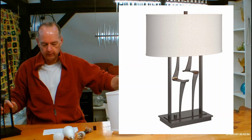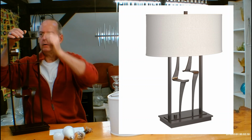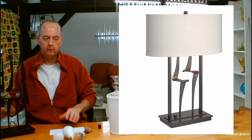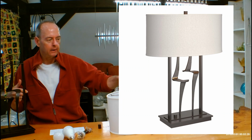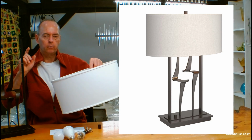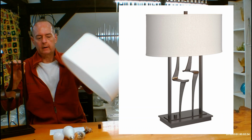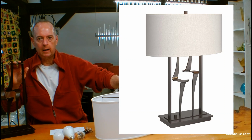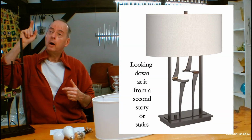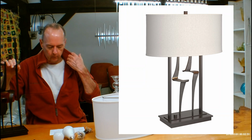So why don't we start playing around a little bit with the lamp itself, since I have it right here. And this is the finial. This is the piece that's going to go on top up here that holds your shade in place. The other thing about this one, which is different from the other one with the round shade, is this one does not come with a diffuser at the top, the glass diffuser that sets inside of this. Historically, a long time ago when this came out, this was available with a round shade and an oval shade, and because of that we didn't know which one you're going to be getting, so they didn't include the diffuser automatically. It was an optional thing, which you can still order, the optional flat frosted glass diffuser on this. The only reason you would want one is because you would be looking up at it from a second floor and you didn't want to see inside of the lamp itself. Other than that, there's no benefit to it, so just remember those kind of things.